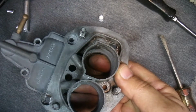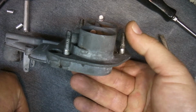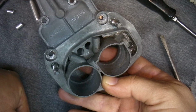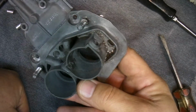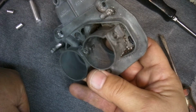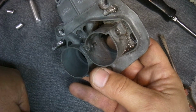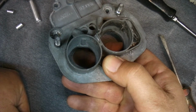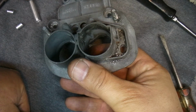It's never worked in this car. I don't know exactly why. Every time I would pull the choke, the engine would die, even though the throttle was opened up a little bit accordingly. I don't know if it's to do with the wild cam I have and the light flywheel, or the leak I had in the throttle shaft, but it just would never work, so I just never choked it. Don't really miss it that much. It was okay, so that's why I'm doing this, and I don't feel that I'm going to miss a lot by not having a choke. So away it goes.